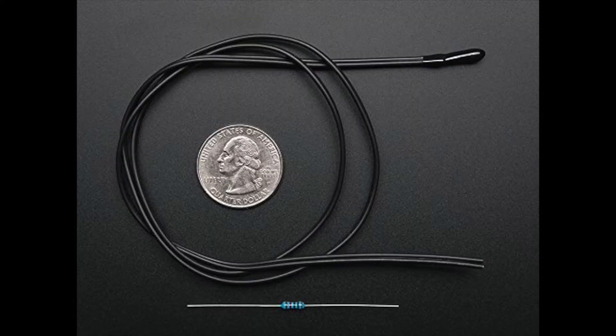So I went searching on Prius Chat and I found a post that says to use this Adafruit thermistor. Some guy had done this before and said it's working great. So I tried it, I put it in. It's been about three weeks and I'm still running good. A real test will be if I make it past three months — if I don't, I'll make an update video. Here's the link in the description for the thermistor I used.